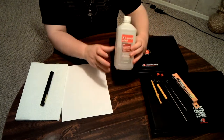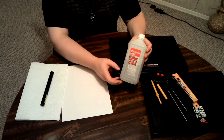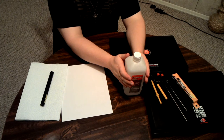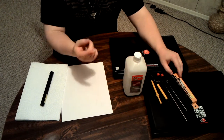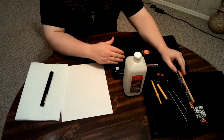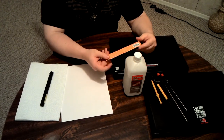You will need high percentage rubbing alcohol or isopropyl alcohol. Either one will work. What you need it for is to clean, because that's what gets the grease off. Because essentially what thermal compounds are is oil and very, very fine flakes of metal. That's essentially what composes these thermal pastes, thermal greases, thermal compounds, whatnot.